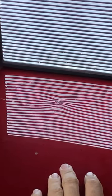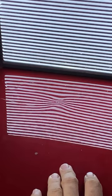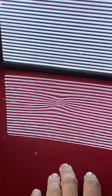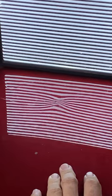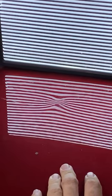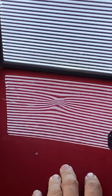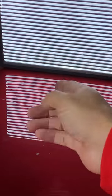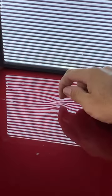Okay, I'm using the edge, and I don't like the edge yet. The edge is just too aggressive right now. So I'm going to keep using that dolly, the ball, the round part of it. Now, I probably wouldn't do it this way. I would probably stop right there, tap down, continue with the tool, and just really pinpoint that center that I want. Okay, let's tap down again.